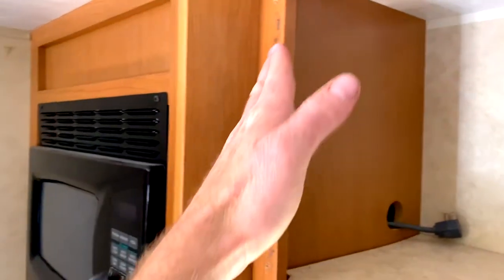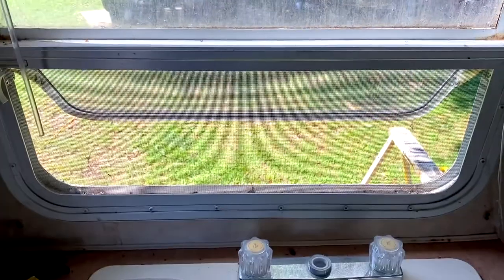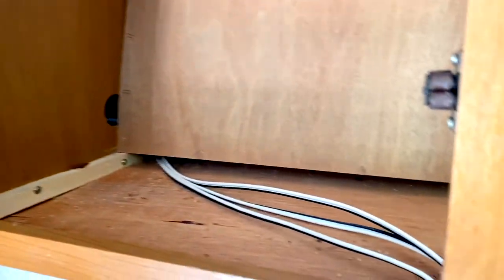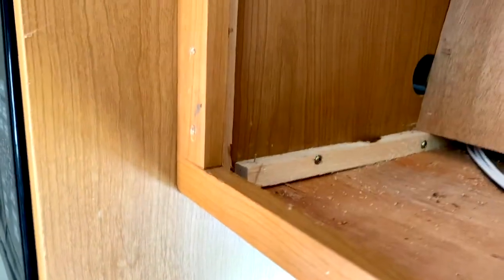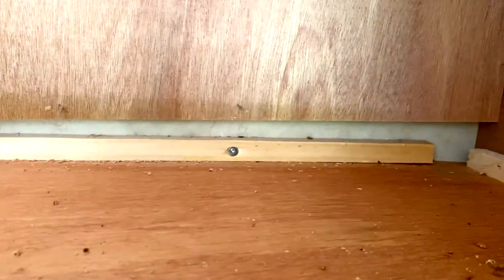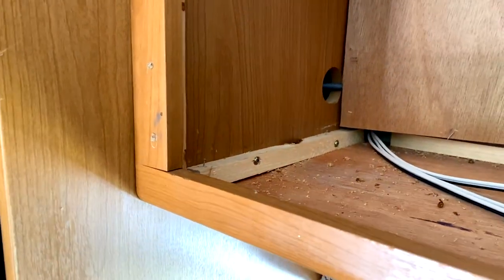You would think that with this piece up here and this coming down, that would be it. However, there is wiring that runs through here for this overhead light right above the sink. In true design, they've got a piece of paneling sitting on top of this false floor and it is stapled down with a lot of staples. You carefully pry that up all around — it exposes your wires — but then you get an additional set of screws on the front and in the back that are holding everything in place. Now I can remove those screws and this piece will come out.